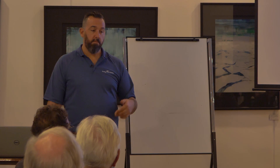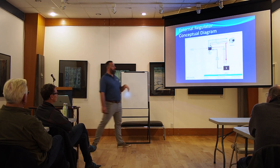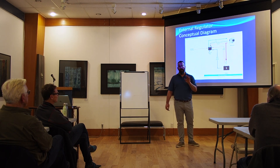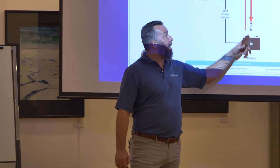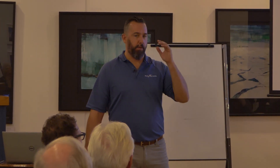This thing is actually figuring out if it needs to charge or not. If it's not seeing voltage, or the voltage is not increasing when it thinks it's seeing voltage but it's on the wrong battery, it says: I see 12V, I don't see a voltage increase — work harder. You can see battery voltage going to 17-18 volts on the wrong battery. A battery can never go to 17 volts — it's a life event. It will never recuperate. That battery is done, toast. So you absolutely need the voltage sense wire at the same battery where the alternator is connected.